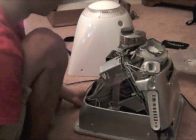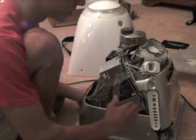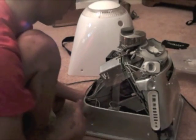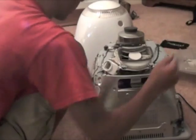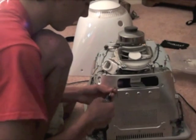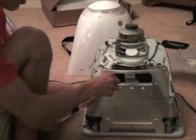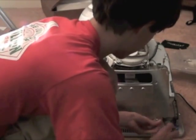What I do is I don't let myself touch anything on the other side of this little wall right here. The motherboard is right here and all the CRT stuff is on the other side — don't touch anything on the opposite side of that wall, it's just not safe. Now we're going to take off this metal plate guard. There are four Phillips screws holding it in place — separate your screw stacks so you don't get anything confused.